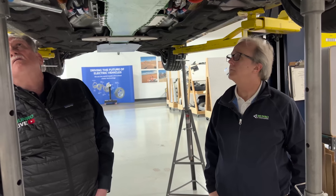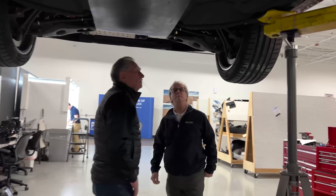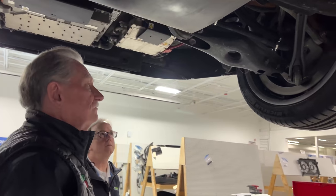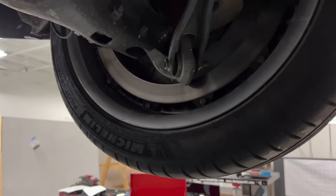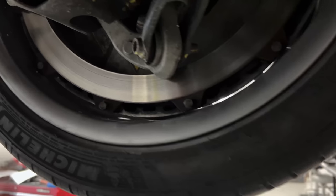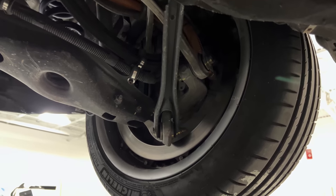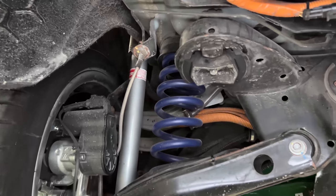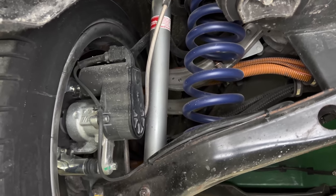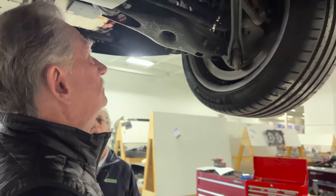The rear looks more like what we remember. The rear only ever had one caliper from the start. You can see there are only two mounting bolts here versus four on the front, and the disc is slightly smaller — less swept area, reflecting the lesser braking requirement at the rear. A new feature back here is an EPB-style caliper: electronically actuated with an integrated motor, which eliminated the mechanical cable and cable puller from the previous configuration. It's now automatic, more reliable, and even weighs a little less.